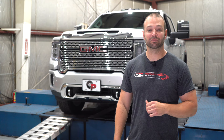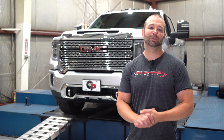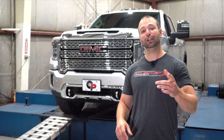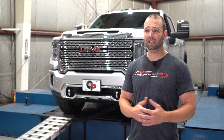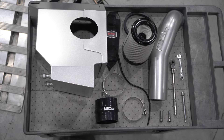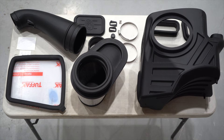Does that mean you should discount this whole video? No. It's a good test. Power numbers show we definitely gain power. The airflow numbers show we definitely gain boost. The mass airflow numbers are pretty strong. So I'm going to leave the intake on my truck. I'm not going to tell you which one because honestly I think it comes down to personal preference. Both manufacturers did a nice job and I think they both hit their market pretty squarely. Really the choice is which market you fall in — once you pick that, I think you buy that intake. Either way you're not going to go wrong. You're going to get an improvement in power and an improvement in drivability.